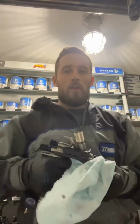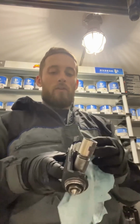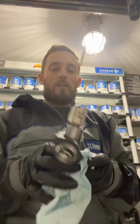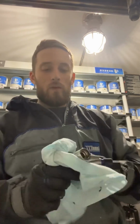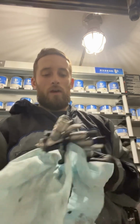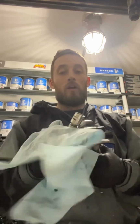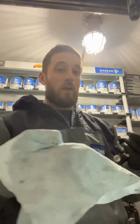Sheesh! Yep, let's go. I know there is a lot of production painters and they all brag about how many hours they can do and this and that, but at the end of the day, if your quality isn't there and your customers aren't happy, you're never going to be given the opportunity to push out as many hours as you can within a week. So just doing something like blending the fenders, I know it gets a little iffy on the quarter panels if you're doing a rear bumper, but even still, taking the extra time and really dialing in your color with spray cards or whatever makes all the difference in the world.